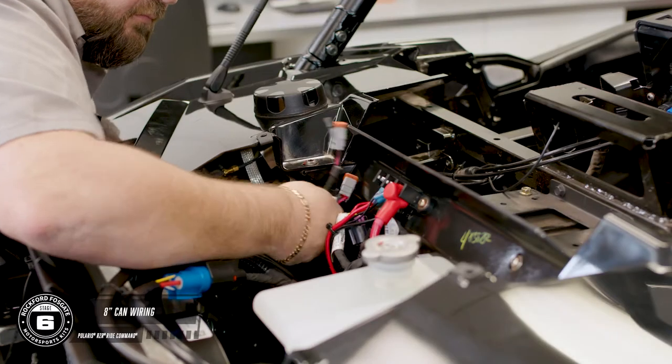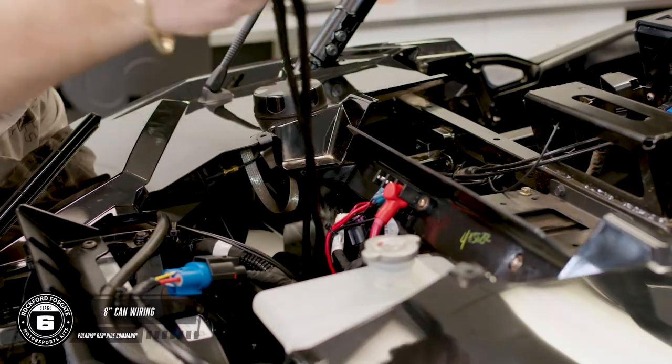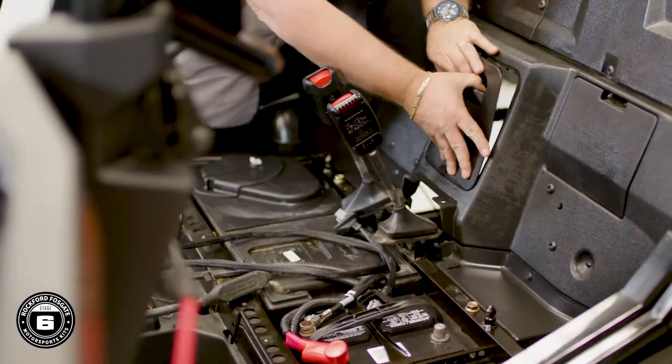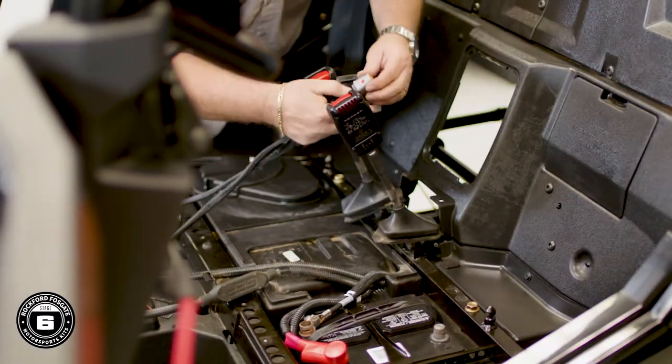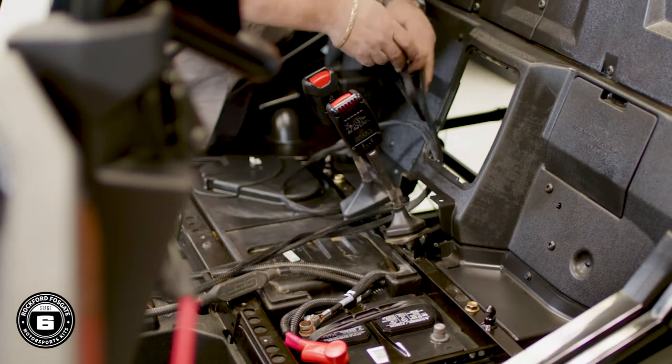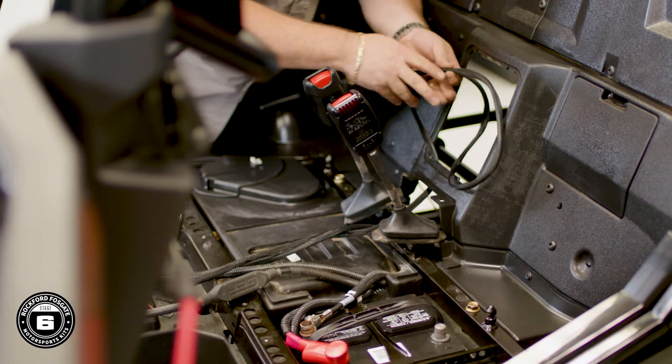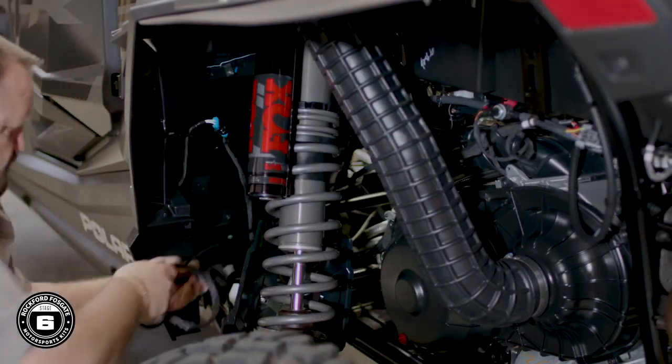Let's run your wiring harness for your MotoCans. Starting at the front near the distribution block, run down through the radiator compartment, go underneath the floorboard and into the center console. Feed the wires through the console and out the rear firewall. Be sure to manage your wiring and do not wrap around any moving parts. Note that there's a red dot on one of the harnesses, which means it goes on the passenger side — red for right.